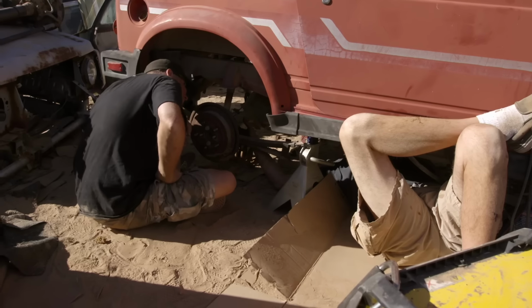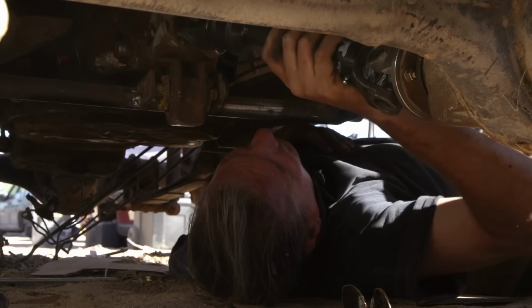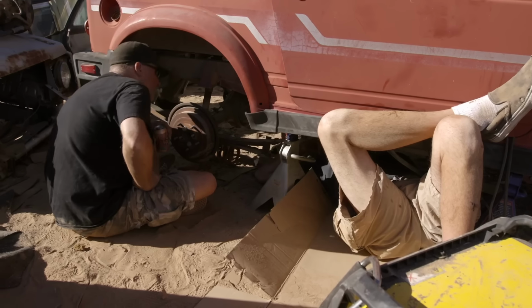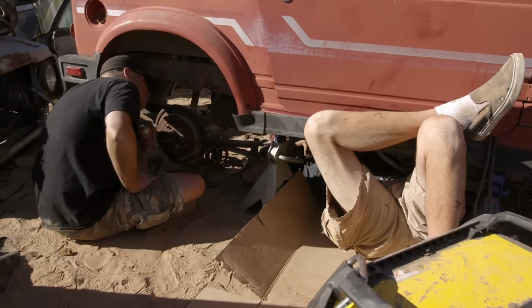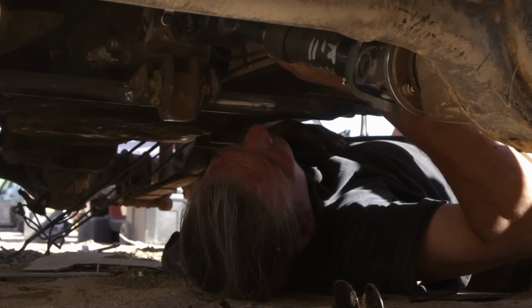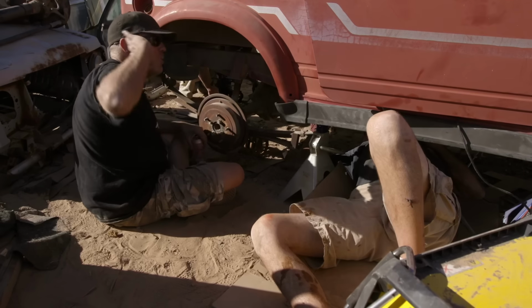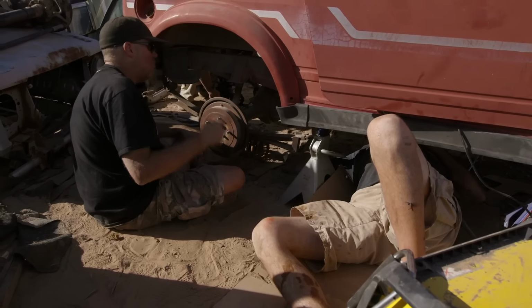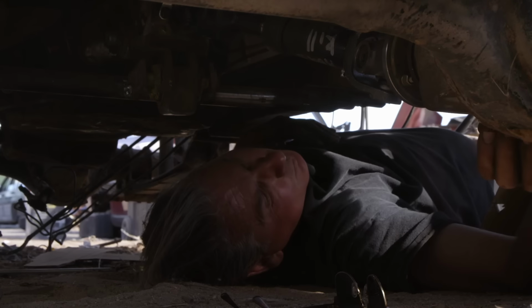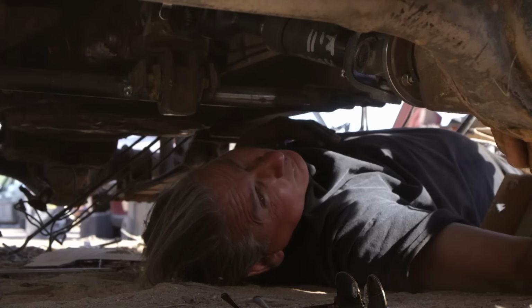Oh man, there's just a problem right here because if you turn this drive shaft, it stops turning because the U-joint yoke binds with the transmission yoke. Standard 4x4 problem. It's because we need a centered diff. It's really tight on the retaining strap side too, but it does clear. Yeah. Let's ignore it for now, do everything else, and if we have time, we'll put a better rear end in the thing and center it. And then if we don't have time? Then we grind that one and just drive carefully.